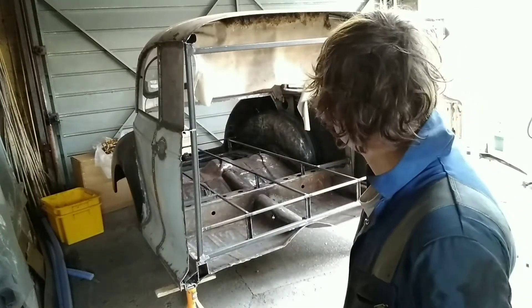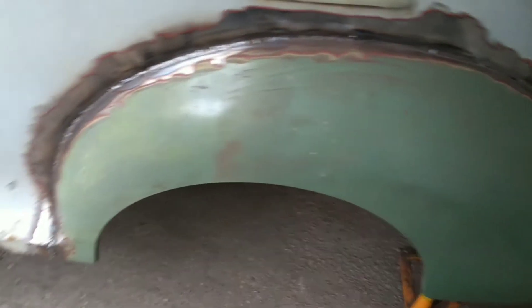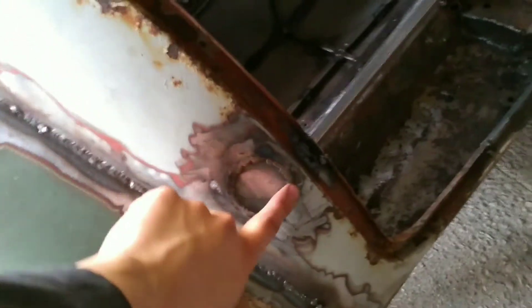What has also happened is I've welded the other wing on, but annoyingly after I welded it on I discovered this hole and this entire edge is made of filler. That's a bit annoying because it was the wrong shape once I welded it on and I wondered what was going on - turns out it was filler and all sorts. I've also welded up the petrol cap hole and repaired the bit where the bar for the base of the boot would normally go. We're pretty much ready to put that front bit on.